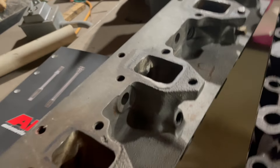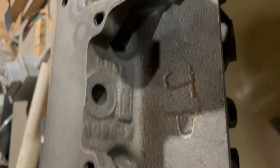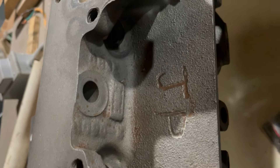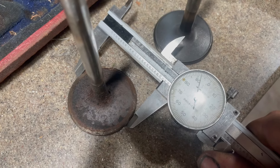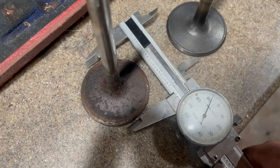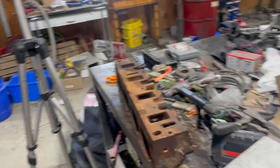You can see I'm very proud of it — my initials are on it. It's a C8OE casting, really hard to read, but it has the four-bolt exhaust as well as bigger valves, which I measured. This is a true Cobra Jet head. It was magna-fluxed and had one crack across the intake valves — apparently nothing to worry about since it didn't go all the way through.